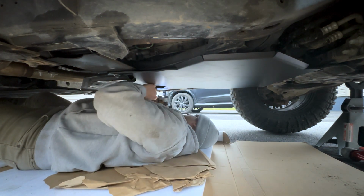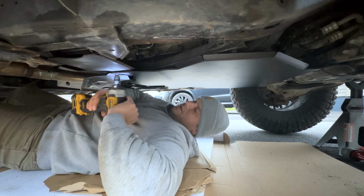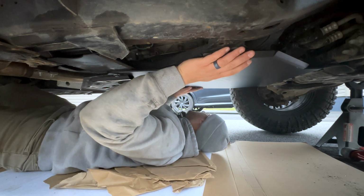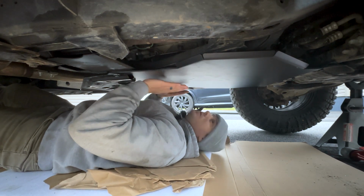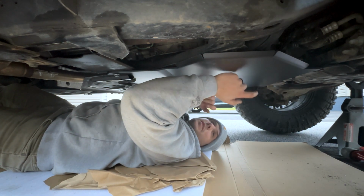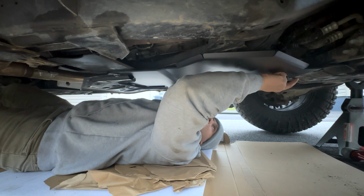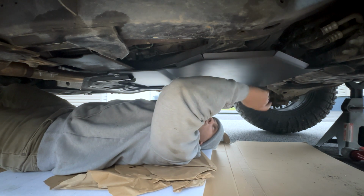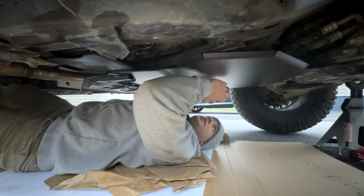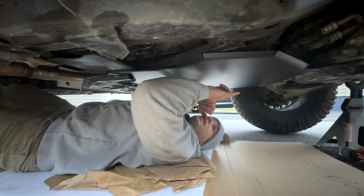Yeah, I don't think they really sent parts out that you would be using if you were just adding this into everything else. I think this was sent out with the hardware more for their whole system to work together, because in the future, maybe they didn't realize it, but they need 4 of those washers because the factory holes for the engine skid plate are too large for the heads of these bolts, because they're not flanged or anything at the end. It's just a hex bolt, so it's kind of sketchy. So I'm gonna have to grab 2 small washers for that, and the job's done.